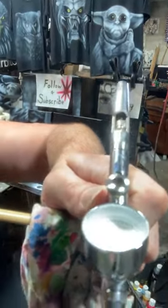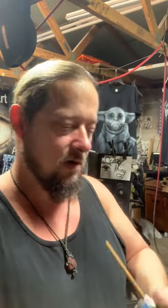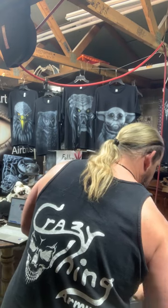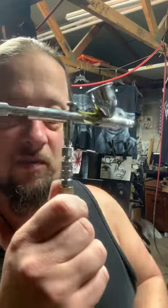Notice there's still plenty of room to change and add - if I wanted to add paint I could, if I wanted to add reducer I could if I didn't like the flow. I like to let this sit for a few minutes so that the paint and the reducer can blend and get happy together - it'll be ready to paint in just a few minutes. Next I'll set up my black gun - it's got a B on it. I connect it with my quick disconnect and there's a little bit of water left in it from yesterday because when I put these up I put a little water in so anything left doesn't dry out.